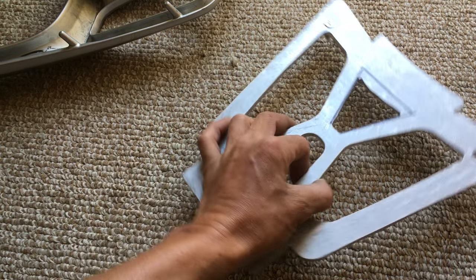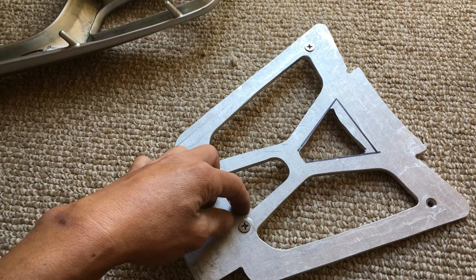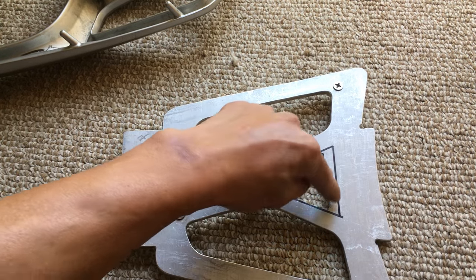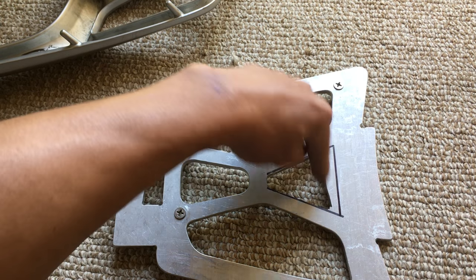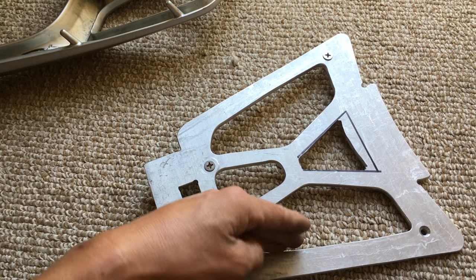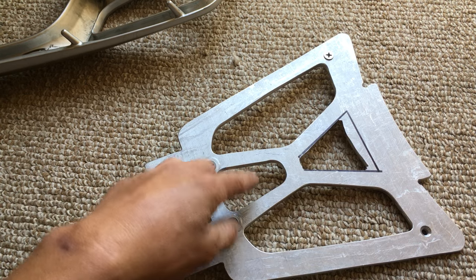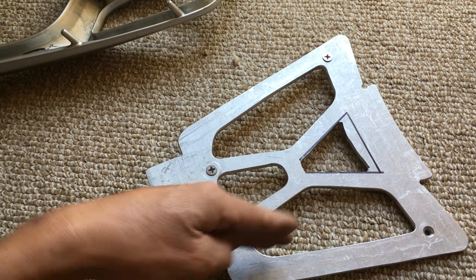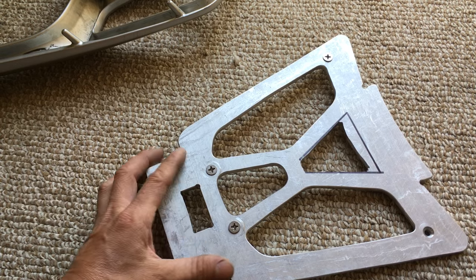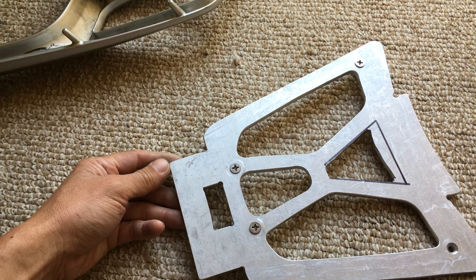This thing took a really long time because everything was literally done by hand. I drilled the holes with a battery-operated hand drill, and cutting these cutouts I used a jigsaw — but because this is metal and because of the thickness and the blade size, I wasn't able to do curves, only straight cuts. So it took a lot longer than it would with wood, because wood you can curve pretty easily. Even though aluminum is a soft metal, all of this was cut and filed by hand.